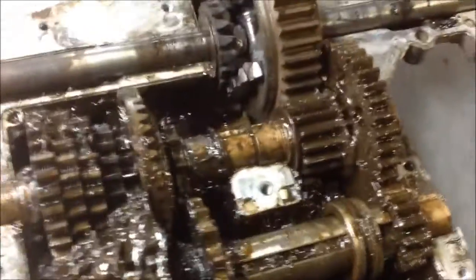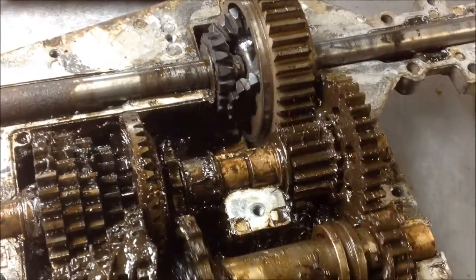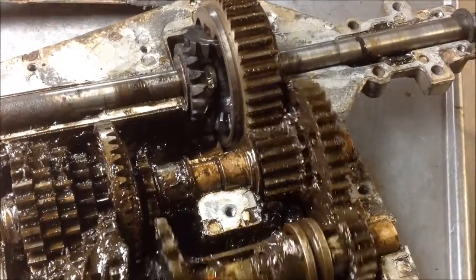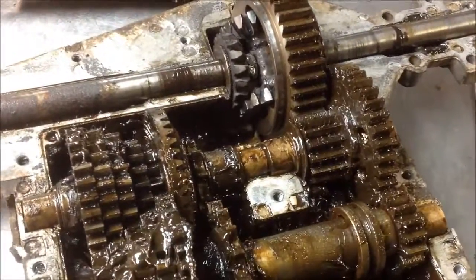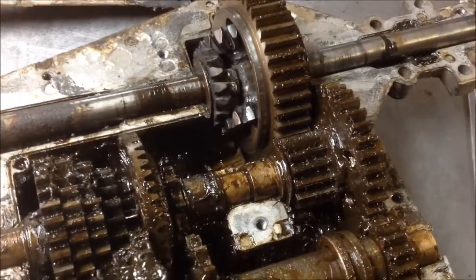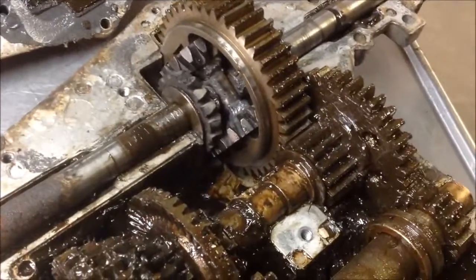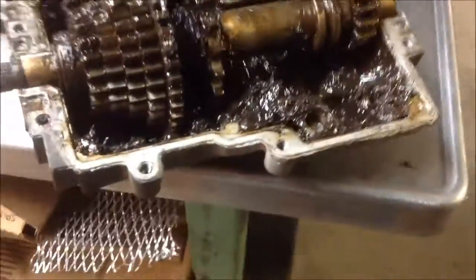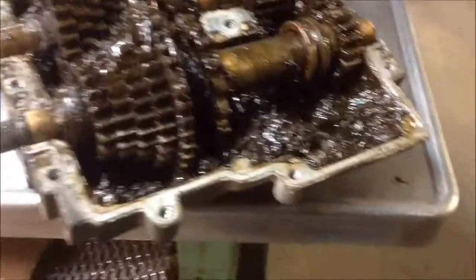Now if I spin this like so by hand, just like it should, both axles are spinning, that's locked up tight, and now you can see that I've got a weld in the same place on the bottom. So there's two welds. Weld on the gear set, and there's a weld down in there. So that's it. Not big welds. I used a 3/32 6011. It's a real penetrating cleaning rod, and it works well.